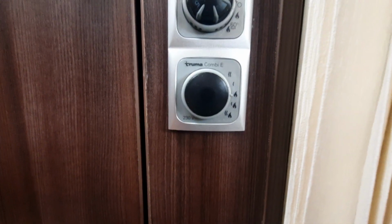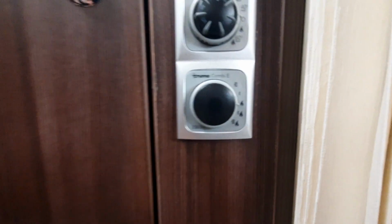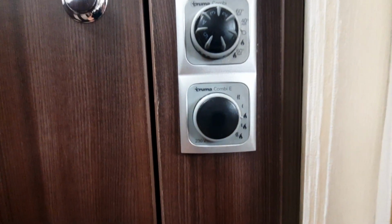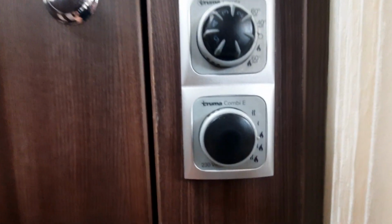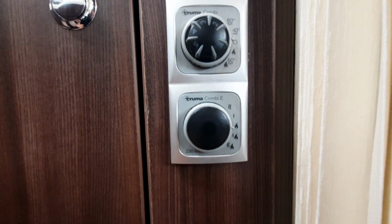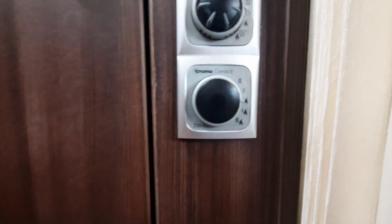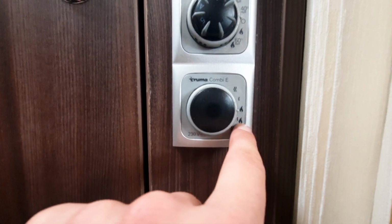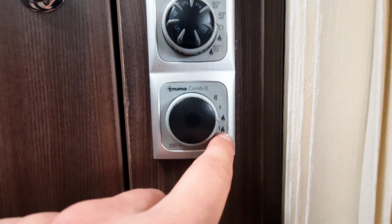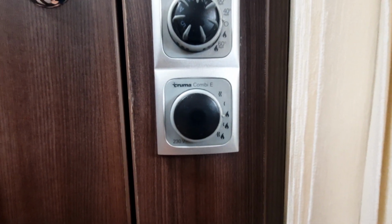Below that is your electric. So if you're hooked up on a site and you don't want to use your gas, you can run it off electric. And it's the exact same just on the electric system. The one little squiggle is about 40 degrees. Two little squiggles is about 60 degrees. That basically implies that it's 1 kilowatt electric and 2 kilowatt electric, so depending on what power output you've got. And then below, as I say, that's for your water, and then below you can run it for your vehicle temperature and your water on 1 kilowatt electric or 2 kilowatt electric, again depending on what you've got.